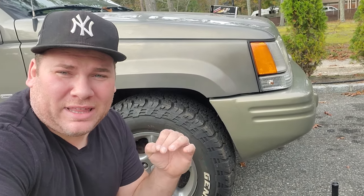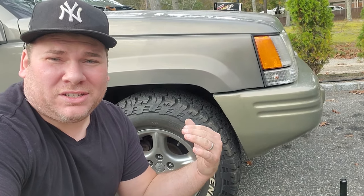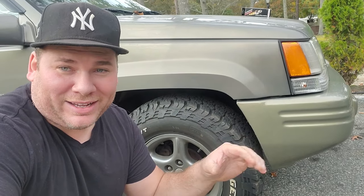It's been about five days since I pulled that wire from the O2 sensor. We still got the check engine light because it detects the O2 sensor's not plugged in. But it's been running fine, so that just confirms that the O2 sensor was the problem. I put well over 100 miles on it and no other issues have arisen. Let's go get in that new O2 sensor.